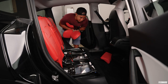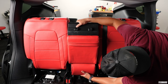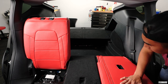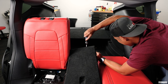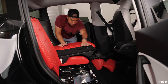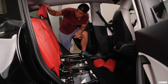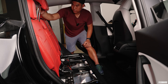Now that we have everything wrapped, this is the fun part — putting everything back together. Put the middle piece down first and line it up. Once that's on, let it come down and just like we did earlier, lift this up. Use a T20 — I have a little ratchet screwdriver which is really helpful — and put that clip back into place. Put it back up, that looks really good, nice and clean.